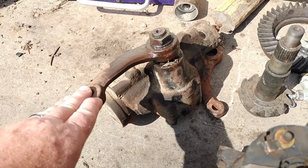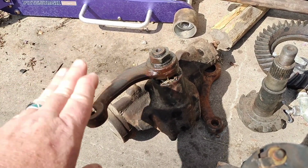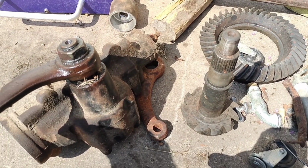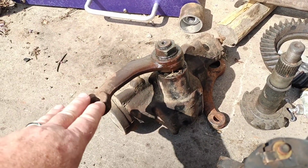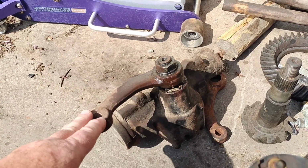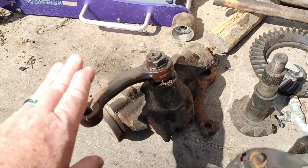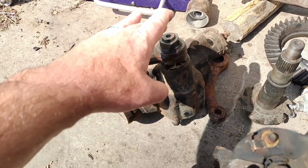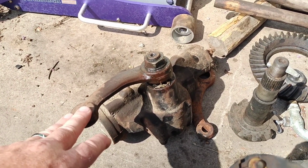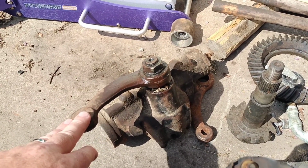Anyway, this is the power steering gearbox I was going to put in the Firebird, and it's not the original. But we need this pitman arm, even though it's awfully dang close to the same as the Bonneville one. In both applications, use the gearbox placement behind the cross member. We kind of call it rear steer. But whatever, we're going to use this one. This gearbox, I think, is a WS6 79 Trans Am box. It's a real quick box, but it has limiters for the wheel travel.